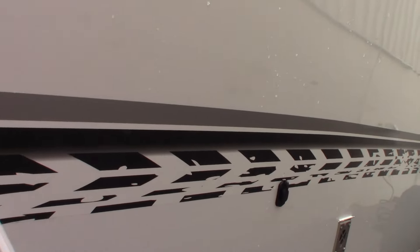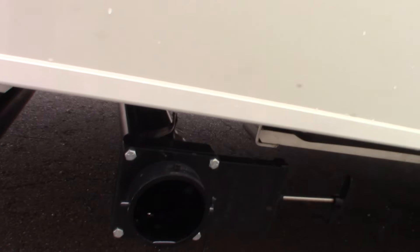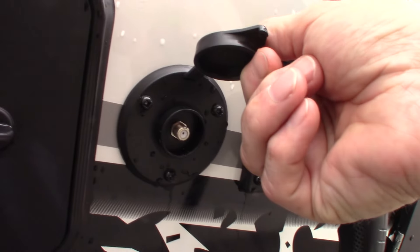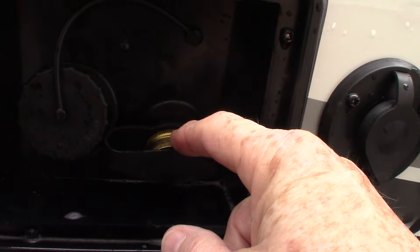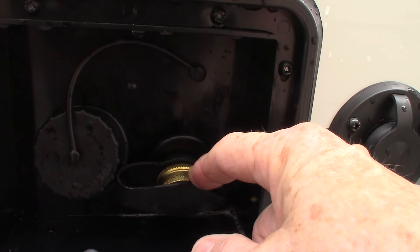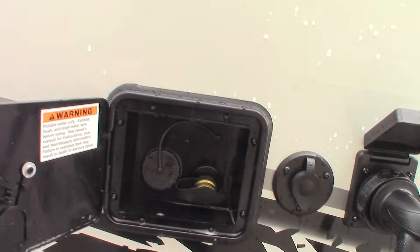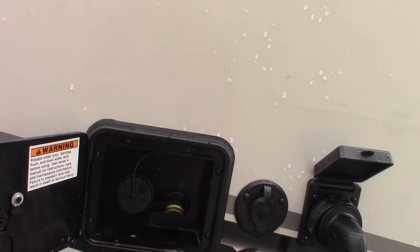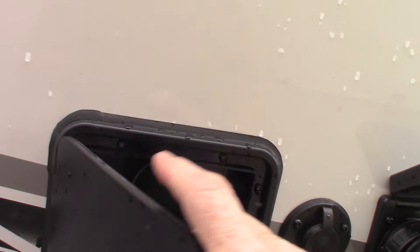The battery is inside — it's under the seat along the wall; I'll show you that when we get inside. Your storage for your dump hose is right here. That's your furnace vent over there. Your 30-amp, 30-foot shore power cord is here. This is just a cable/satellite or internet cable-through. This covers up your city water hookup right here. City water hookup is the most common way to get water to the trailer. If you're camping someplace without city water — boondocking or whatever — you can pre-fill your fresh water tank here: unscrew this cap, fill the fresh water tank, then use the onboard pump when you get where you're going. If you have city water, just hook the hose on here and you're all set.